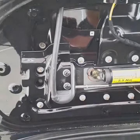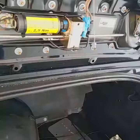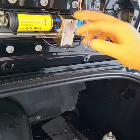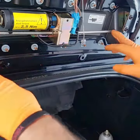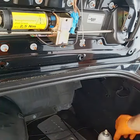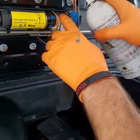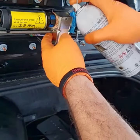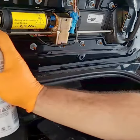Now you can remove the cover. Next, we need to lubricate the gear right here, and then we have the shaft that turns the wing — we need to lubricate both of these points, and on top as well. Once you remove the cover, spray a little bit of lithium grease on the gear, and also spray some on the rotating points.